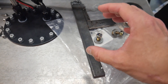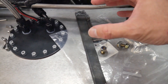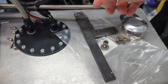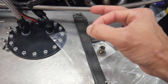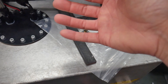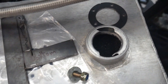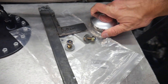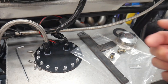I just ordered another fuel sender. The one I'm getting has a shroud around it — the one I had was all open, and I was afraid that with this foam continuing to expand and not being cut precisely, everything could move around inside the tank and get the stopper stuck. For about a hundred bucks, that's a lot of security. Being way out on a trail with no way to know how much fuel I've got left is a real problem — there's no way to see the fuel level unless it's right at the top. That's why I went ahead and ordered the shrouded fuel sender.